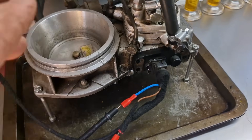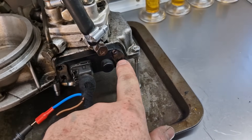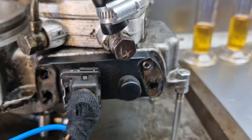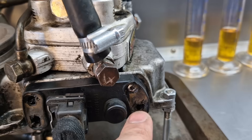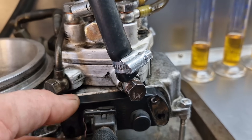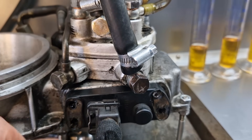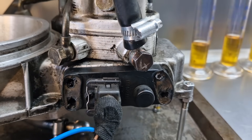These settings are of vital importance. This one is off. I've pre-removed the screws — when you do this there's a silicon glue in there, so you need to take all the screws out and get rid of all that glue. When you're trying to adjust the sensor it can force itself back against the rubber. Get all that goo out, have just one screw in there to adjust it, nip it up, and then put a bit of black silicon in afterwards.